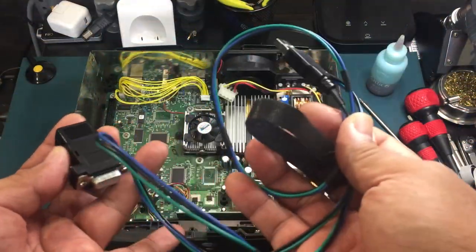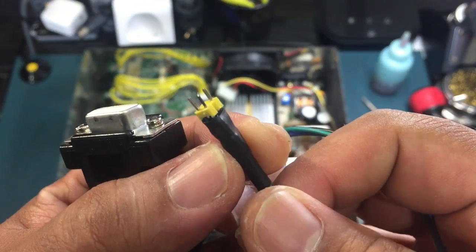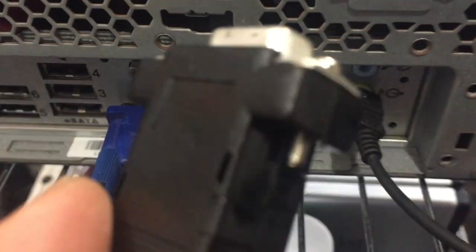Hopefully you backed up your EEPROM, but if you haven't, you can build one of these EEPROM readers. I'll leave a link for the instructions on how to build them in the description. What you also need for the reader is a PC with the serial port.